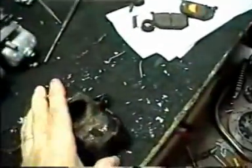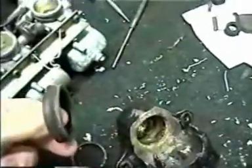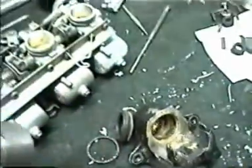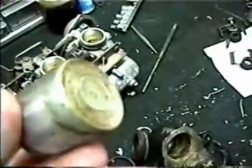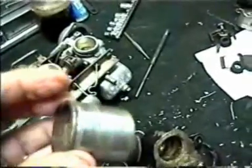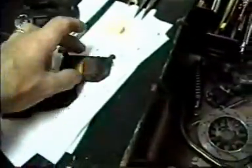So what I've done is I've taken away the oil, the O-rings. They stayed intact, great for me, and I'm going to clean those guys up. And if you take a look at the inside of this piston, I'm going to go ahead and sandblast it. The good news is the outside, which is the part that's the most important, is fairly clean, so I'll be able to clean that up real well. Brake pads are okay. I'm going to sandblast the rust off of here.